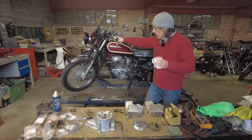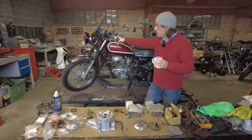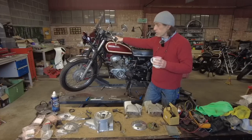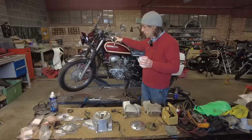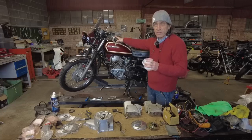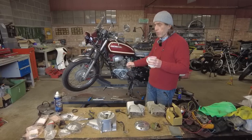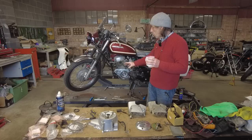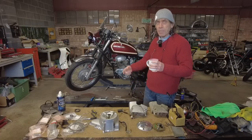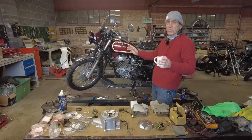Back to the matter in hand - I was going down to the Cotswolds the other day because this is my everyday ride. I got halfway between Buckingham and Milton Keynes when it started playing up, misfiring, and it was down to 20 miles an hour. They're not blisteringly fast but this will do 70 miles an hour with the panniers and fairing fully loaded. It was rush hour, 6:30 in the morning, dark - I thought I was going to get hit up the back. I pulled into a farmyard, whipped the cover off, found a bit of oil in there, cleaned the points, put it back together, checked for a spark, fired it up, and it ran. It got me all the way to the Cotswolds and back - a round trip of about 170 miles. Happy days, I made it home.